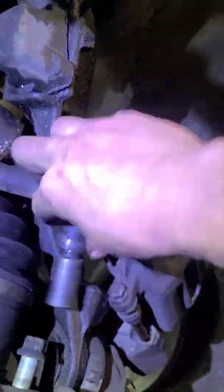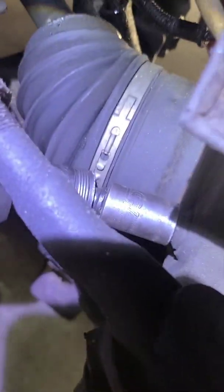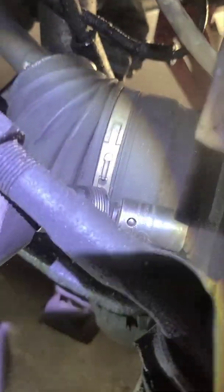Access to these bolts right here — those are 15 millimeters. What I like to do is come in with a swivel and pull them out like that. Got one there, got one there. Then I'm going to turn this wheel all the way to the left so I can get that bolt on the back. Okay, so we got the wheel turned. I wonder if I can use my left arm to do this. I'm going to probably break that one by hand.